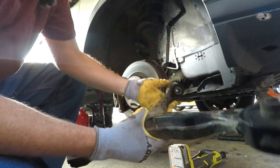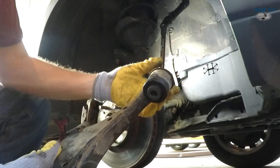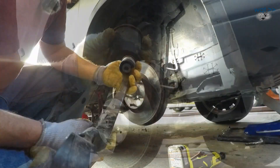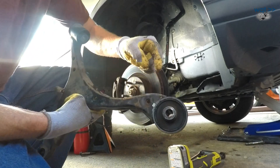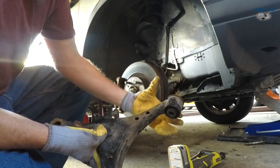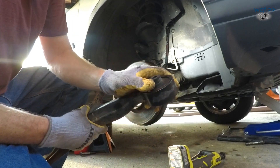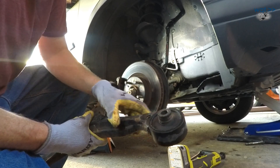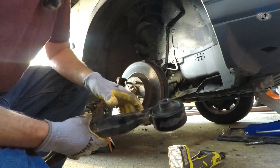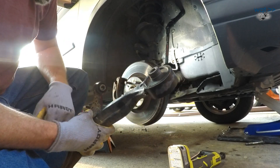There's what it looks like when it comes out. There's another bushing over here, but this bushing is small and tight. This is typical of what you would find on Toyotas — I haven't seen a Toyota have a bushing issue like happens on this one, because this here has a lot of width to it and a very narrow bushing, so it doesn't just rip out. But all it takes is that little bit of tearing that you can see in there, and this no longer has a proper stable connection up front. You'll get a lot of vibration and harshness while going down the road when your bushing looks like that.